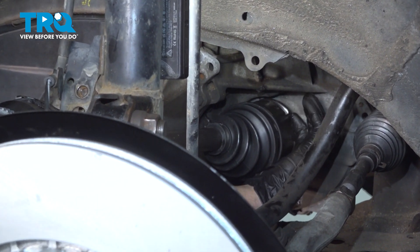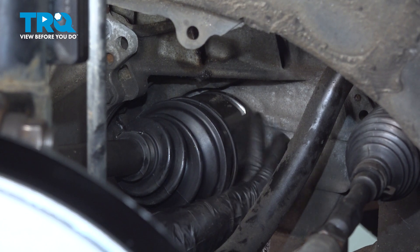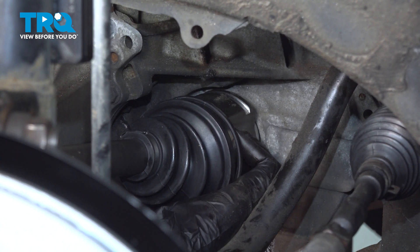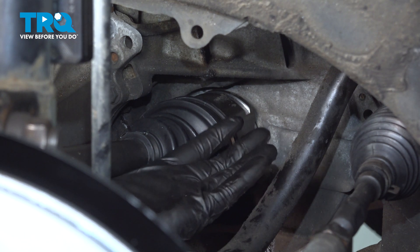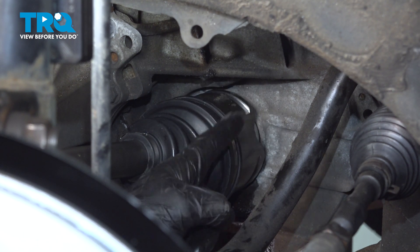At this point, I'll just have a quick feel along the backside to make sure it's completely seated. Continue on to taking hold of the axle closest to the transmission and give it a nice tug, trying to pull it away. If it slides outward easily, it's not locked in. Assuming it does not pull out, you can continue.